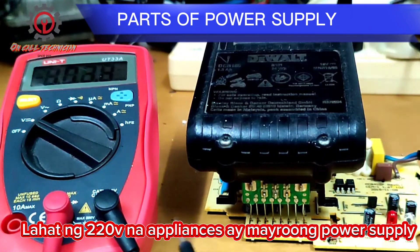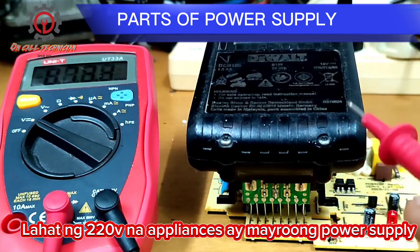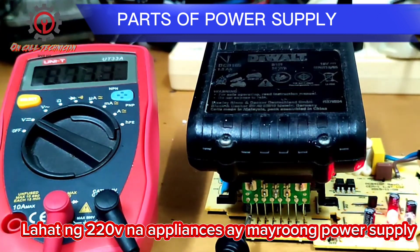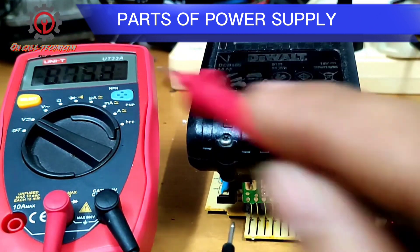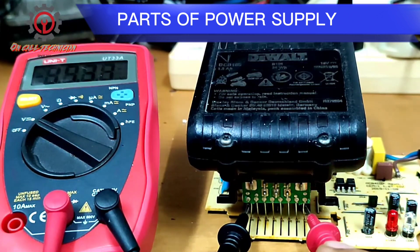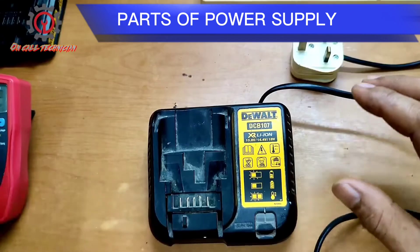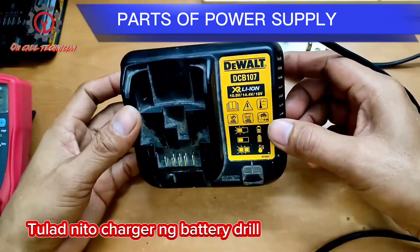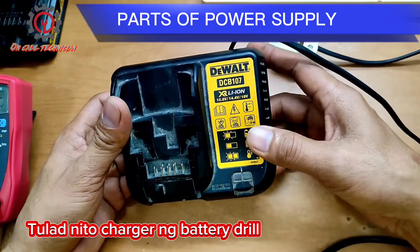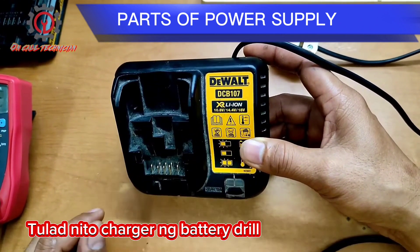Let's check if this battery charger for the wall is now charging. This side here is the negative and this side here is the positive. Look at the multimeter — positive to positive, negative to negative, now I got 18.45. Welcome guys to my YouTube channel, today we're going to check the DEWALT DCB107 charger.